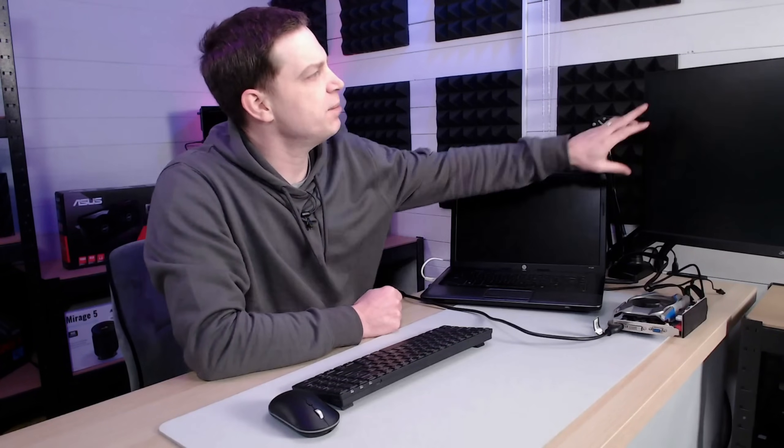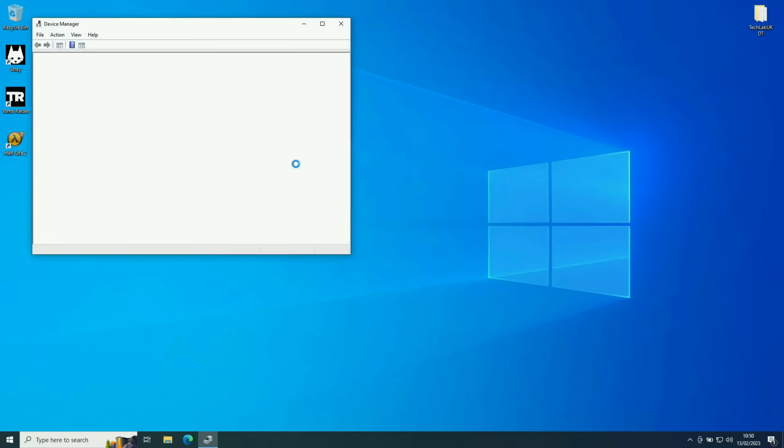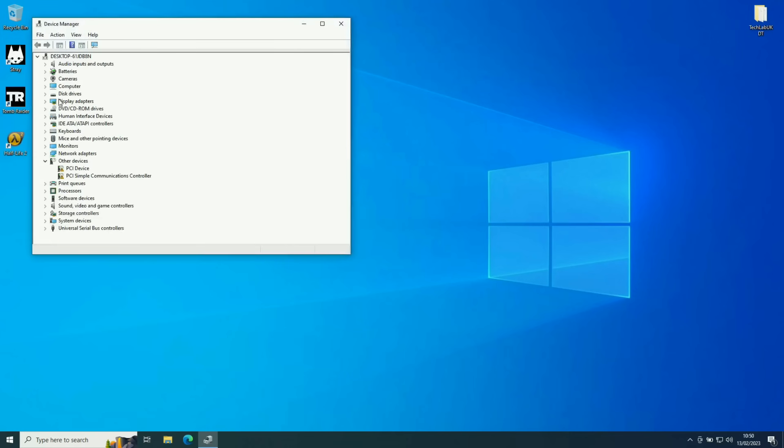The machine is coming on — there's no picture on the laptop screen but it's starting to show up on the external monitor, and we can see the HP boot screen coming on. The graphics card is working, sending the signal out the cable — everything is connected perfectly fine. The machine is up and running and we've installed the latest Nvidia drivers for the GTX 750. They're not officially supported anymore, but let's double-check the system can see it as a GTX 750 by dropping into Device Manager. Under display adapters, we can confirm it's showing as an Nvidia GeForce GTX 750 — the card is detected correctly.